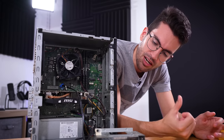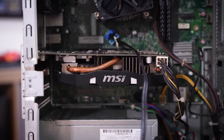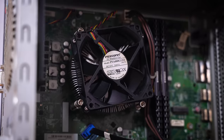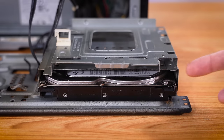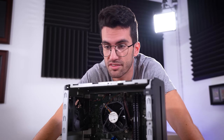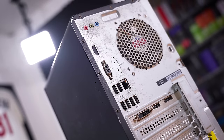Before we try powering this on, this combination of hardware is actually pretty decent for an entry-level rig. A 1060 is still perfectly viable if you can find them for decent prices, and the 6 gig variant is probably the only one I'd look at — you can find these for well under $100 now. A 2400G will also pull its own weight; it's an APU, you can technically run it as a standalone graphics processor as well. Something that should be on everybody's upgrade list is a replacement storage drive — hard drives for boot devices are no bueno in 2023. Even in very bare-bones budget rigs you can find one terabyte SSDs for under $40 today, and that will drastically improve boot times and program load times.